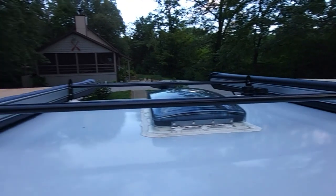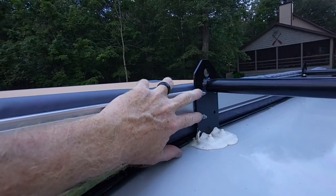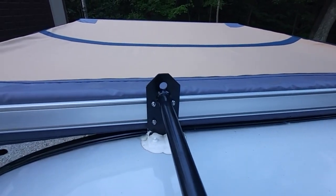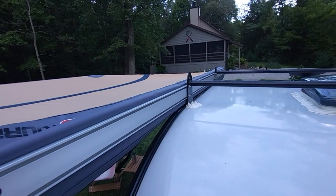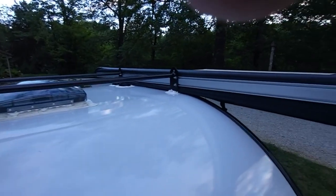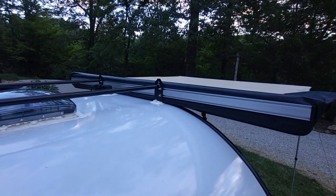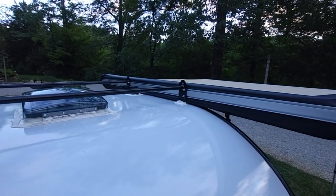On the ARB side, they use two 10mm bolts with nylock nuts, plus a third one on the backside — they came with six, intending three on the front mount and three on the rear. Stiffness-wise, when you grab the ARB and move it, you move the whole camper. Over on the Napa side, when you grab it, you actually deflect the extrusion before you move the camper. Going down the road I don't think it'd be an issue since the air load runs the same direction as the awning. Just a little weaker on the extrusion, but for the money it's still a deal.